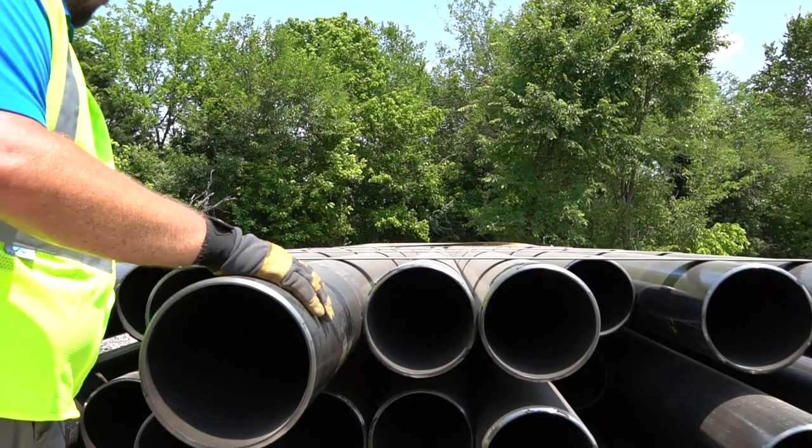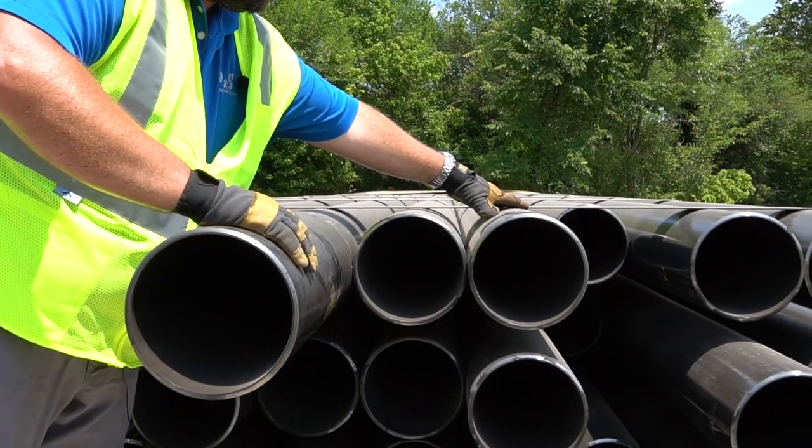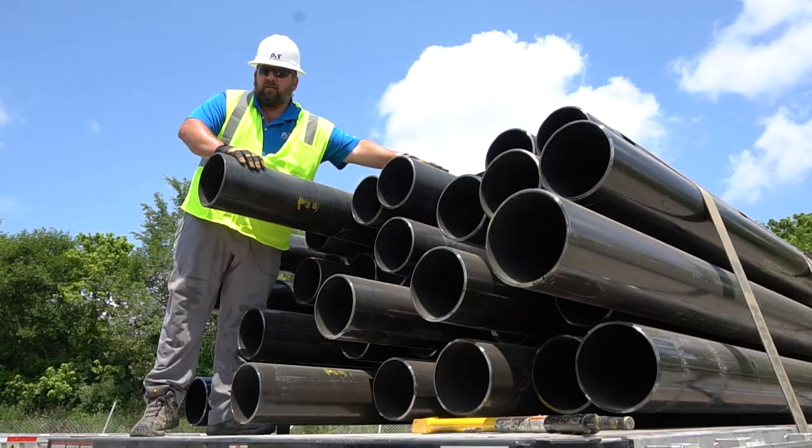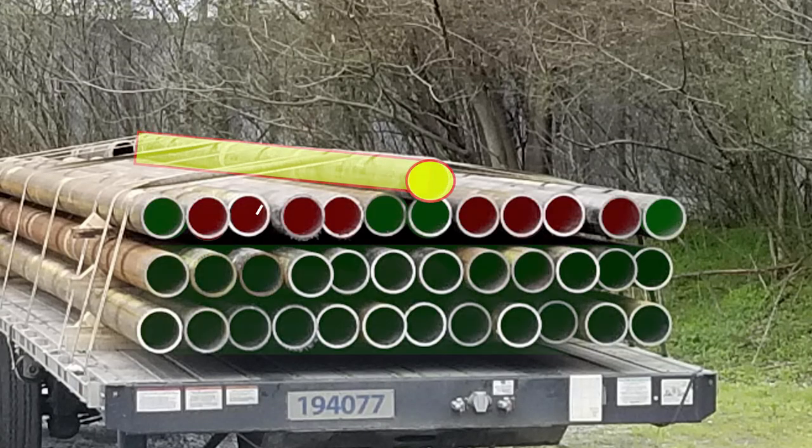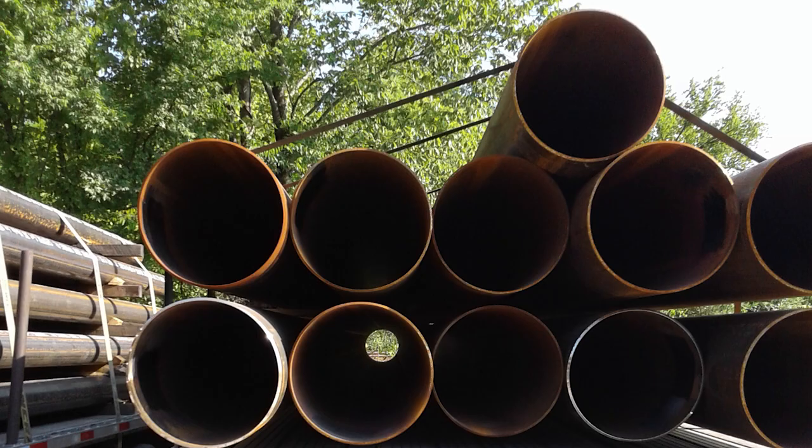This load is level across the top. The strap makes contact with everything here. This load is legally secured. But if you've got an extra piece here where this strap's elevated, you can get where you've got the pieces in the center right through here that aren't secured properly.